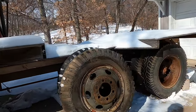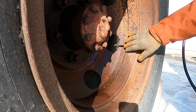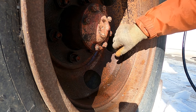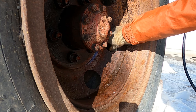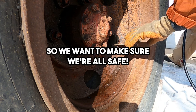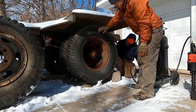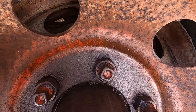Let's move on to the rear end. On the back end, it's common to have the valve stem go toward the inside of the wheel, so that way if it blows up, your hand isn't reaching around there. So we're going to undo this one from the inside. If this thing blows, it's coming straight out this way, so we want to make sure we're all safe. We're going to pull the lugs off — take the outer nut off first, then the inner one will come off after you get that outer wheel off.